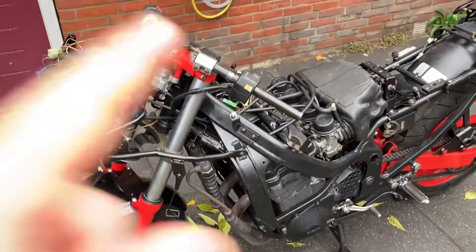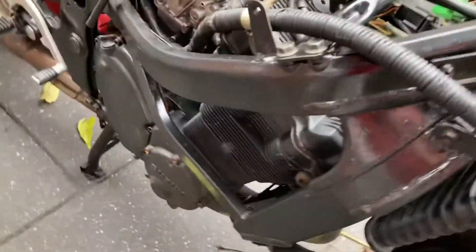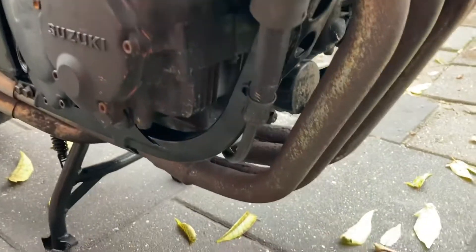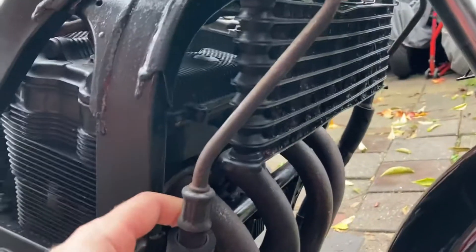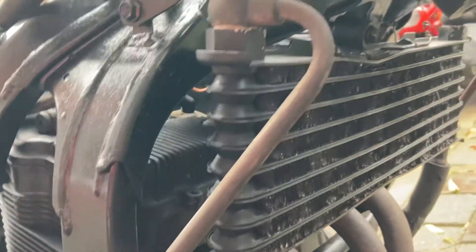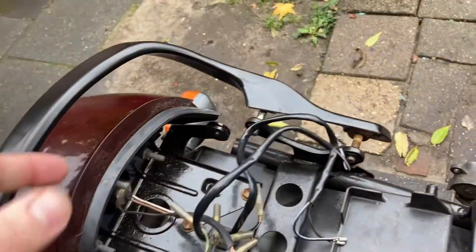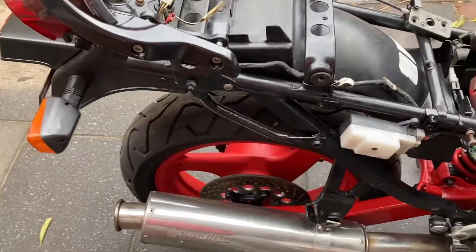What I'm going to do now is fire up the bike, keep it running a little bit, and then change the oil. The exhaust is still not fixed on this side, so when the engine is warm I'm going to take off this side of the exhaust to have access to the oil filter, then let the engine cool down. Then I'm going to take off the oil cooler, because it was damaged in the accident — broke off one of the holders, there's a dent, and a lot of places are damaged — so I'm just going to replace it. That'll give me much more access with this side of the exhaust off. Meanwhile I'm going to finish up the rear end: hook up the cable, put back the hose, put back the seat, put back the rear brake — so the rear end should be completely done.